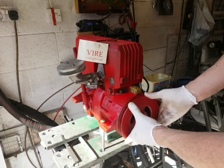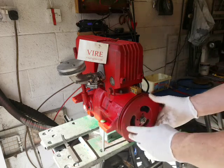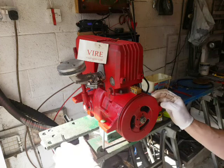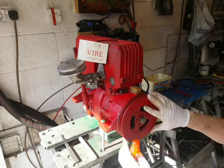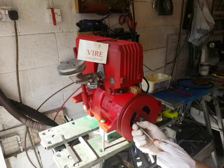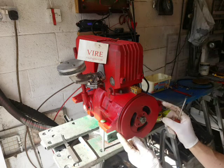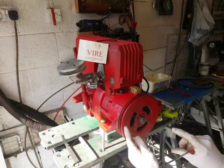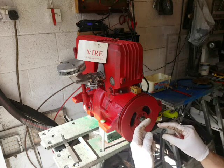The points should be just starting to open about here and they should be closed. I'm going to get down and look and use my screwdriver to put the heel of the points in. And remember, if you've just changed the points, you need the heel away from the flywheel — otherwise if the heel's too close it will snap the end off and the points are ruined.